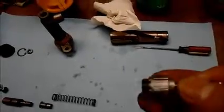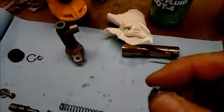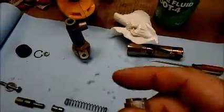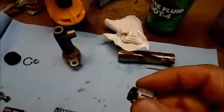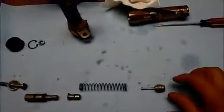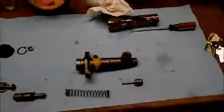If I can get you a close-up, you can see that when it's in the retracted resting position, these little tangs are going to be touching the bottom of the piston bore and the seal is retracted to let the fluid flow past — kind of like in these three little gaps. When you apply pressure it will push that piston, and the piston will act on this rod and press that downward, causing it to seal off the fill valve and press out the outlet instead of the fill pipe.